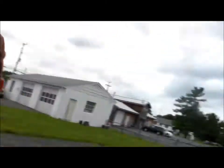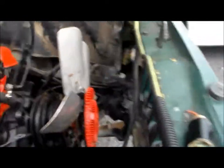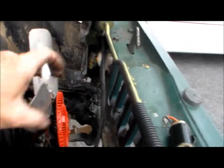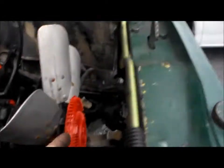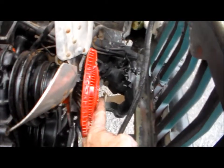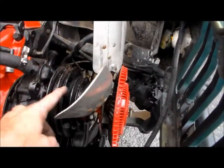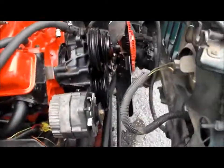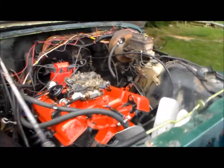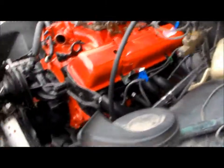Okay, Freddie here. Today I am putting the alternator on, which I have to do a little rigging. I gotta take the fan off because the radiator fan — the six-cylinder radiator — comes about right there, so I have to take this off and put an electric fan on. This is what it looks like so far. I got the wires hooked up, the headers hooked up, and the fuel line ready to be hooked up now.